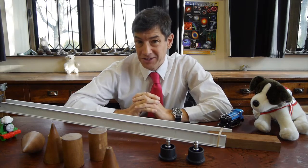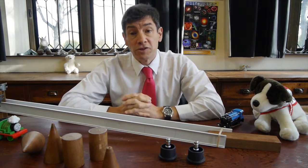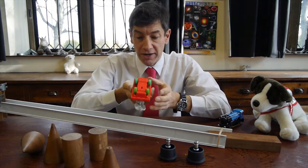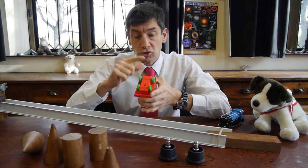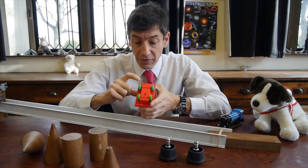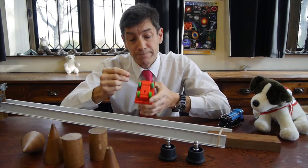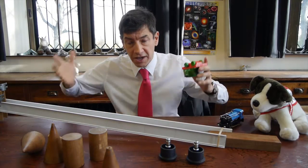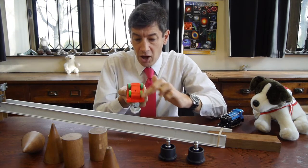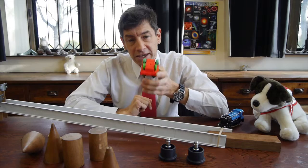The shape of the wheel is critical to answering that problem. The first thing to look at is what the wheels look like on a train or the carriages behind it. Train wheels have two interesting properties: if you turn one wheel, the other one turns — they're joined by an axle directly. That's not true of cars. Cars have wheels with gearing in between called a differential, but in the case of older trains and normal carriages, if you turn one wheel the other one turns as well — they're directly connected with an axle.